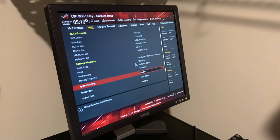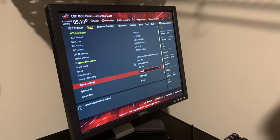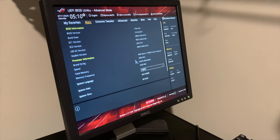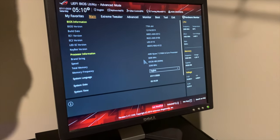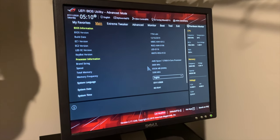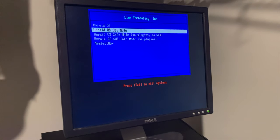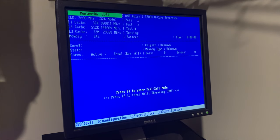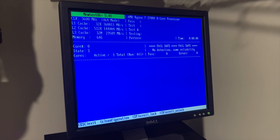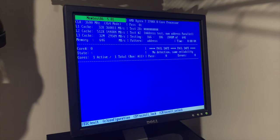So let's take a look on this monitor and see what needs to be done. The first thing I'm gonna do is just make sure that my memory is actually set to 3200 megahertz, since we installed the new stuff. It looks like those changes are sticking, so we don't really need to do anything here. Now we're just gonna boot straight into the OS and select the Memtest86+ option, enter fail-safe mode by pressing F1, and let this run for the rest of the night.